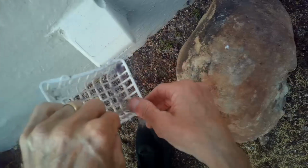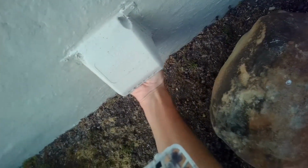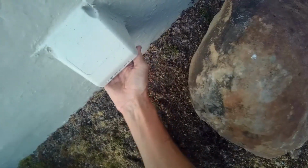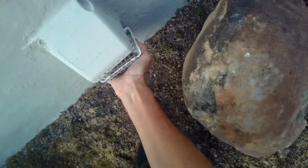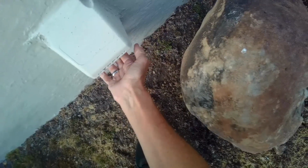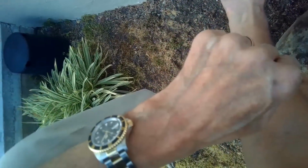So that's a nice looking flame. But if you notice it goes out too early, you may want to go out behind the house where the dryer vent tube leaves the house and make sure there's nothing caught in there that's preventing the airflow. The airflow should feel strong at this point. It should feel about the volume of a hair dryer, and it should be nice and hot. And then if you're just out there in the back testing it, you should feel the hot air lasting for 3 to 3.5 minutes.